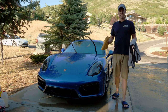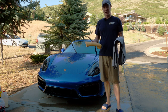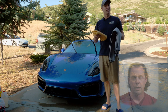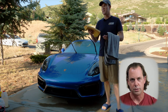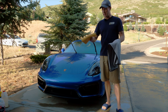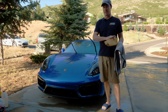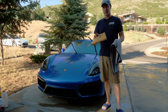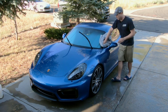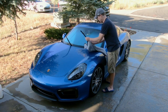Once you've got the water turned off and everything's pretty much cleaned up, you get to move to the drying stage. You can use two different colors here — this is where color-coding your towels comes in handy, same as color-coded towels for raw chicken versus vegetables. You want to use either the gray microfiber or this really super absorbent towel. Once you've got your towels sorted for speed shine, windows, and the dirty rag, they're all different colors. Get drying right away — as soon as you've finished all your washing, you want to dry immediately so water spots don't form.